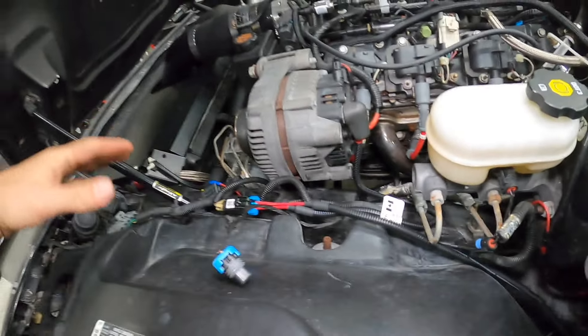Let's take off the front one. We still have things somewhat apart from the Delrin bushing upgrade since we had all the control arms off. In order to get out your monoleaf on the bottom, it's mounted the same way — four bolts here, but it is on top of your control arms. So to get that monoleaf out, you have to take out your upper control arm bolts, support your lower control arm, and lower it down to relieve the pressure off the bottom of the monoleaf. You'll also want to disconnect your sway bar, then you'll be able to get the monoleaf out.